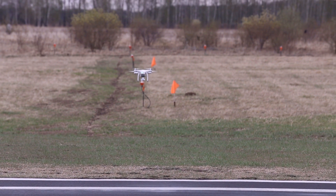Now that we've fixed the compass error problem, we still have one step to do and that's to calibrate the compass. In this case we have the DJI Phantom and we need to do it according to the instructions. It's also important to remember that we have to have a clean open area — a clean field — in which to do this. No metal, no surrounding objects that are going to create problems with the compass. It needs to be a clean open field.